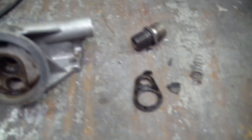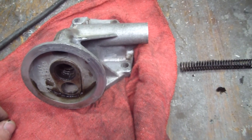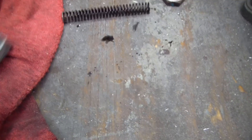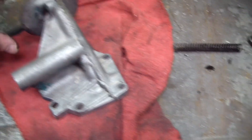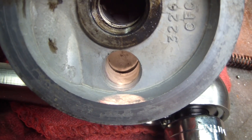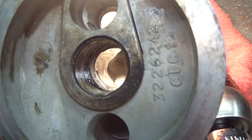I got the rest of the oil filter housing apart and here's where that oil filter bypass is, along with the pieces that go with it. It has this funky fiber disc that's kind of hard to come by. I had to pull the pressure relief spring out because this valve pokes into the channel where I'm going to have my sandpaper roll. If you look in there you see a ridge — I'll blend that with the long mandrel once again. I'm also looking at this area after the oil filter — there's a bunch of rough stuff in there, so I'll blend all that and try to get a little chamfer on that one too.